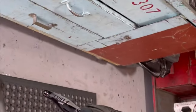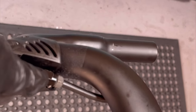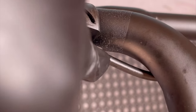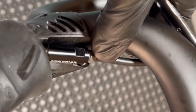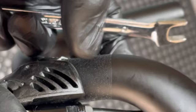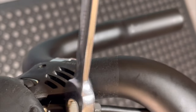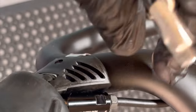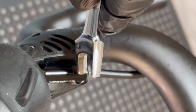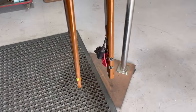With SRAM, connecting the hose is always difficult because it's a 10mm fitting and the other is 8mm. When you're threading that in to compress the olive and make a seal with the hose, you need to hold this part still or it will spin. Usually with a normal 10mm spanner you've got to lift it so high out of the lever that it ends up pulling the hose out. So I've taken mine to the belt sander and flattened it as much as I can so I can get under there without having to lift it really high.